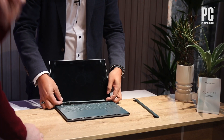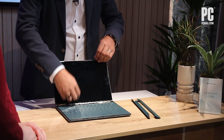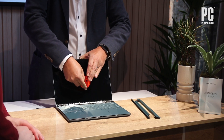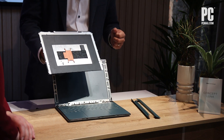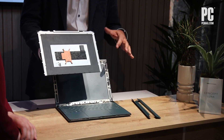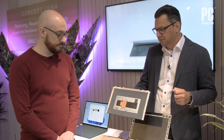When I remove the keystone for the display, this allows me to simply slide out the display — I'm going to use a suction cup. When I slide this out, I can now expose that the motherboard is mounted on the back, as well as the heat sink. This makes it very easy to service the motherboard as well as service the display. We want our customers to be able to repair these things simply themselves so that the life will continue as long as possible, as well as allow us to harvest back these parts in the simplest fashion.